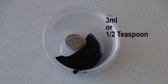For this project, this is probably 3 mLs or roughly a half of a teaspoon of paint — hardly any in the bottom of this one-ounce cup. The reason you want to put such a small amount in your cup is you always want to keep your paint bottle supply closed. It makes it last longer and prevents the paint from skinning over. Also, it's a preventative measure against knocking your paint bottle over if it's sitting on the ground next to the car. Don't ask me how I know this.